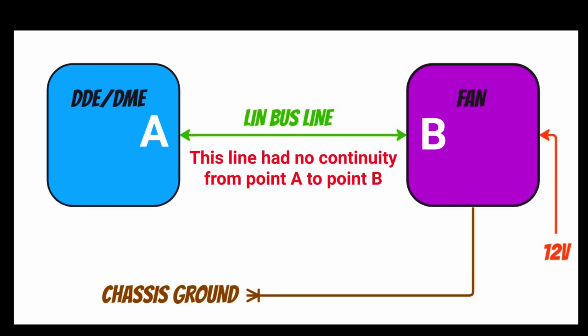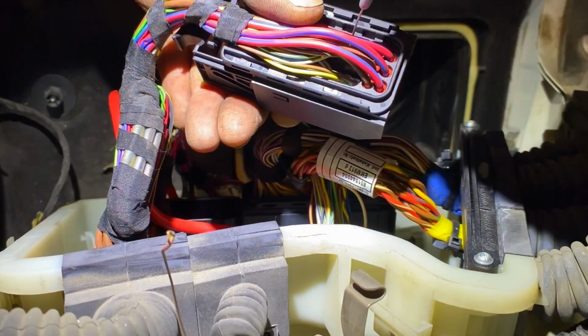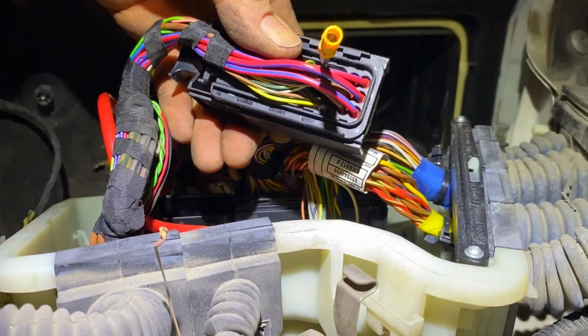Didn't have the time. Customer wasn't willing to pay. Made a decision. Let's just chop the wire out. Let's do a wire temporarily. And then we'll wire it in good and proper and make it pretty decent, so that it'll stand the test of time, so to speak. So that's what I did. Before that, here's another view of the continuity testing. So I'm back probing.